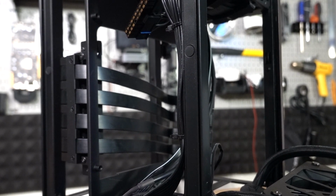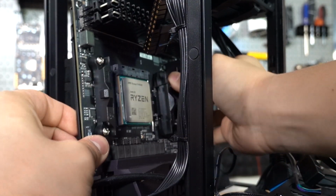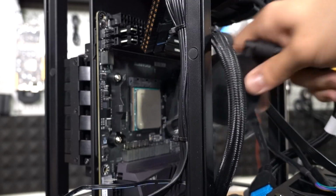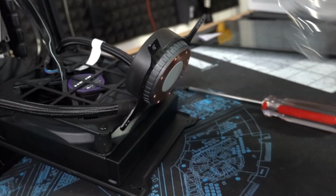Let's go ahead and put this down again. Is that a good angle? That's either the best angle or the worst angle. Okay, that's going in here. All right, make sure I've aligned it. Motherboard IO is facing down. That's looking real nice, Eddie. And if I mount this like so, okay, it's a bad angle. Also, it looks like we've got the Intel bracket on here, which we're gonna have to remove and swap it out with the AM4 bracket.